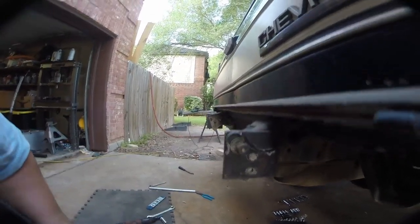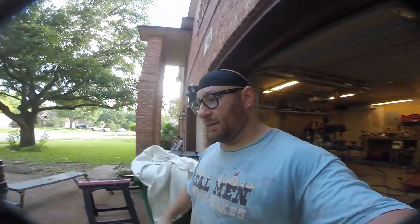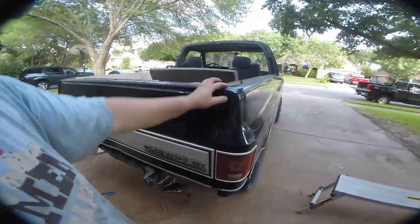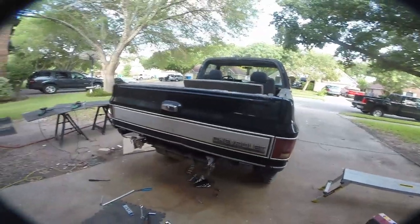I decided on 75 and a half inches total width which should take me right out to the edge of the body line. We want this one to be a little wider than the front because it's got to support that hinge system. Unlike a Jeep, on this truck it's a full-size tailgate like a pickup truck has, so we really got to make the most of these four or five inches on the outside for mounting that bracket.